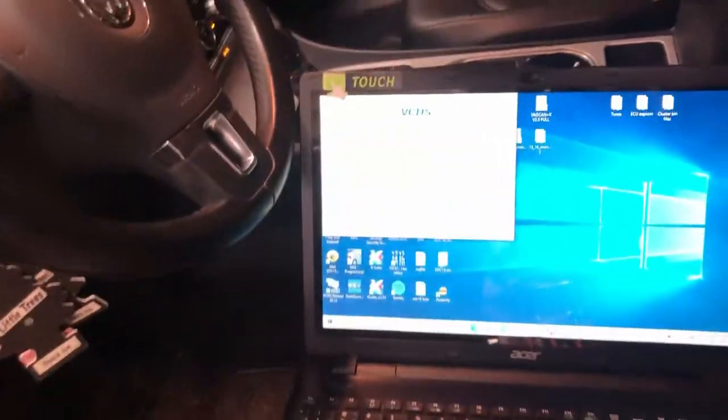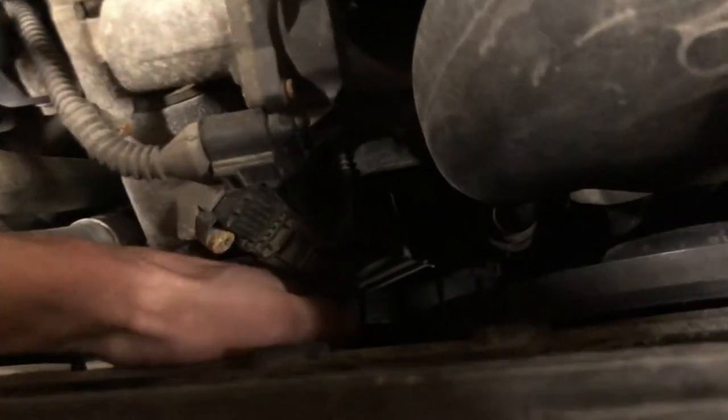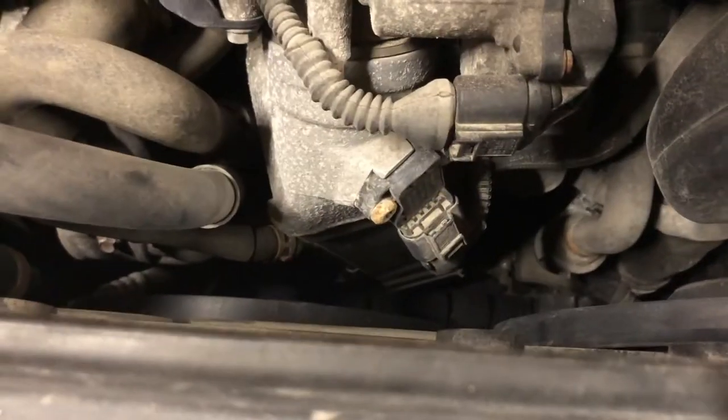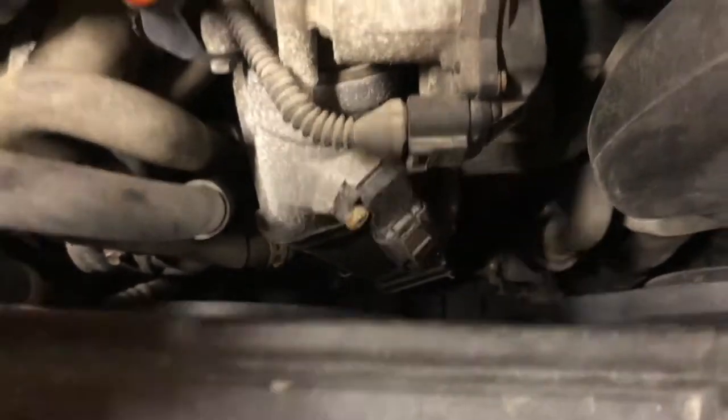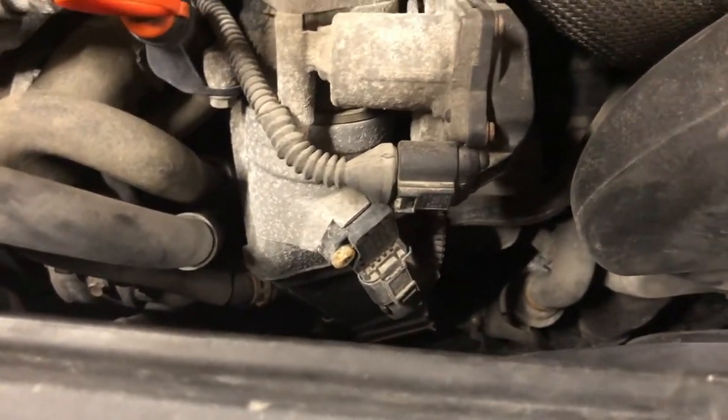She's had that code for quite a while. I just haven't had time to look at it. On these cars the sensor sits right up nice and close to the intake because you've got your water-to-air cooler just kind of down in here. So we're going to pull this off — I'd seen some pictures online of it getting full of green slime and condensation. We're going to pop that off and see what it looks like. Might have to clean the cooler out, not too sure yet. But we'll get this apart and see what it looks like.